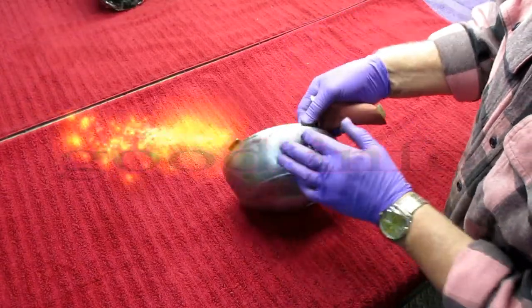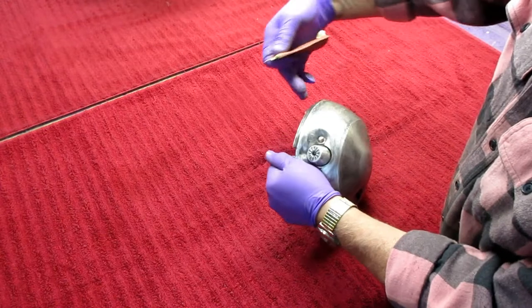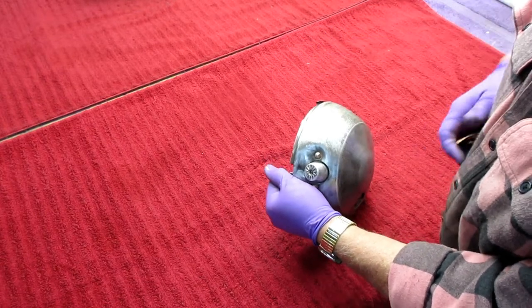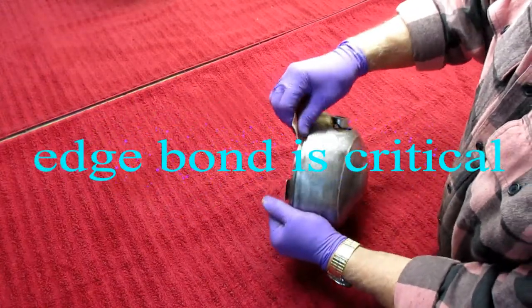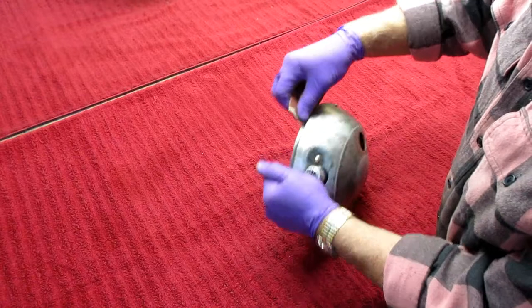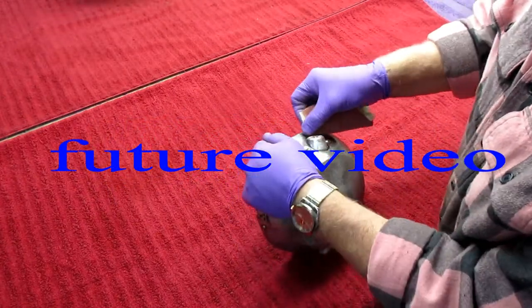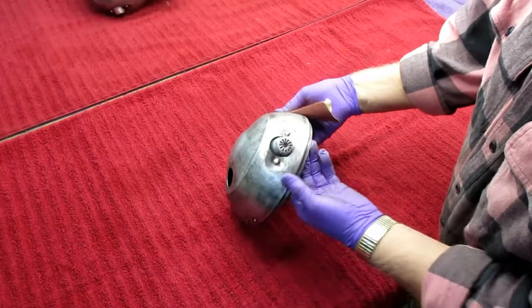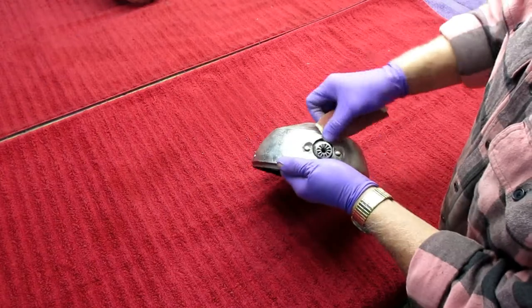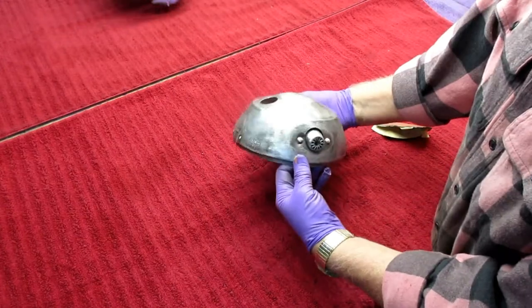This is the most critical part. I want to show this sticky-back sandpaper — I did this with the machine, but I want to do it by hand too as you get down in there. When Dale or whoever assembles the bike, there's going to be paint buildup here, and when they snap that chrome ring on, if it chips the paint we've got a big repair. To get the paint to stick — I know I've had it, Scott's had it, Luciano's had it — the paint just doesn't stick. Paint compatibility is something I'm going to address in a video very soon. That's why I'm so fanatical about the prep — I don't care how long this takes today. We're pretty much ready; let's put a coat of primer on that.